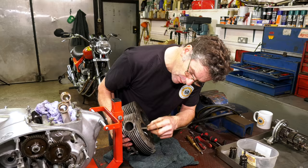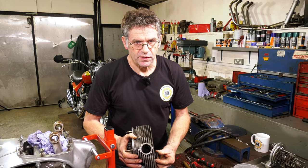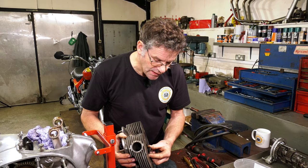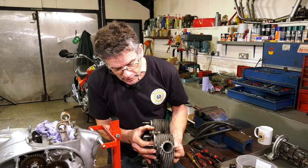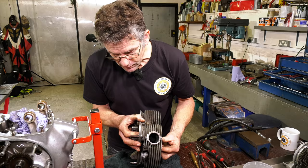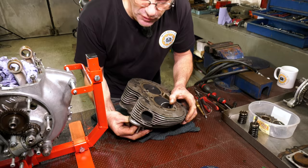With reference to what I showed you with extensive valve guide wear - when we have this amount of wear, it's so easy to think, because you're burning a lot of oil, that it's got to be rings, it's got to be scored. So you're in a hurry to take the barrels off and look at the rings and the rest of it. It's not as far down as that - it's in the top end, it's in the head. This alloy head with worn guides will rattle like mad. You might think to start with it's like your tappet adjustment's out. You're not going to get a proper tappet adjustment really because this is wobbling about so much. When that's in operation it's going to be all over the place, making all sorts of horrible noises. That poor old valve is not going up and down straight anyway - it's wobbling about.